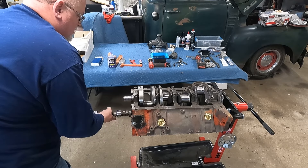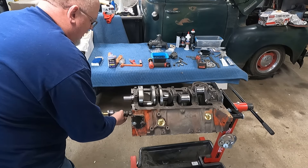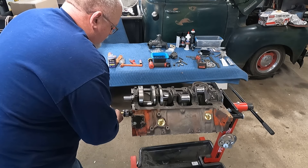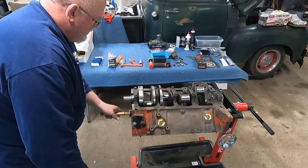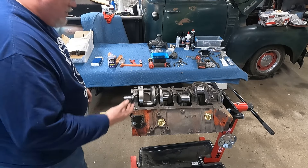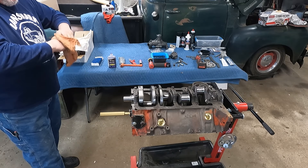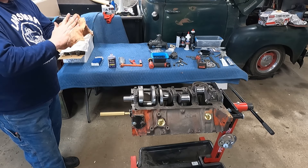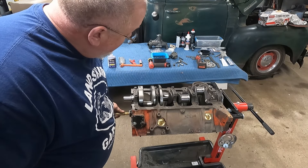When you get back here you won't have a lot of control over that back part. I'll probably leave the cam tool on here while I'm putting my pistons and stuff in so I can move it around a little bit. We're going to find out the quality of this stuff on the break-in table. Once I get this buttoned up and the pistons installed, I'll get my oil pump stuff on, put the oil pan on, flip it over.